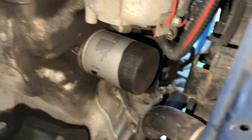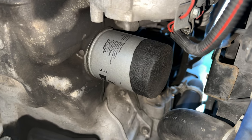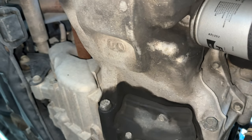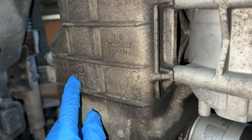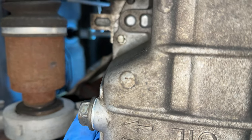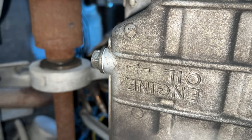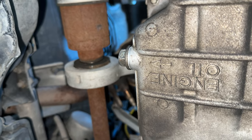I'm underneath my Honda Fit right now. Right up in the front you can see the oil filter — it's going to be really easy to just pull down. If you don't have a lot of upper body strength, you can grab an oil filter wrench. As you look a little further back from the filter, it actually says 'oil' and there is a plug right there. We're going to put the 17 millimeter wrench right on this plug, pop it out, and oil is going to go into the drain pan. We'll take the old oil to the auto parts store and recycle it.